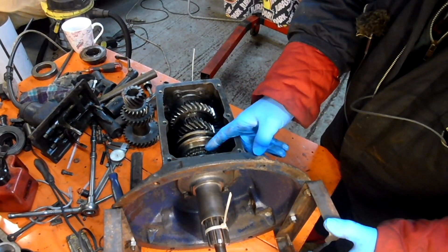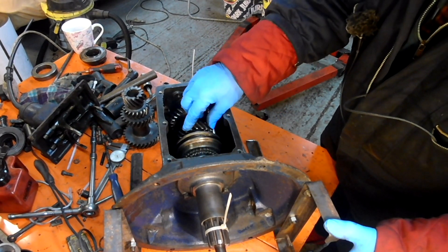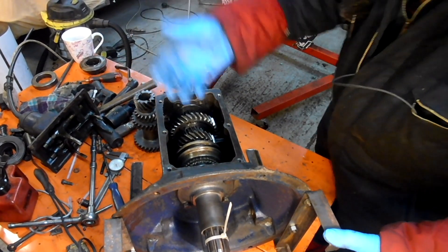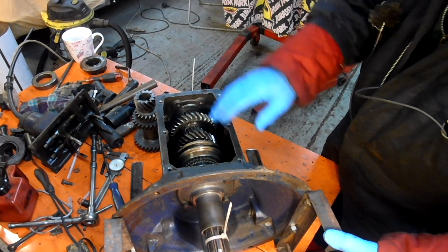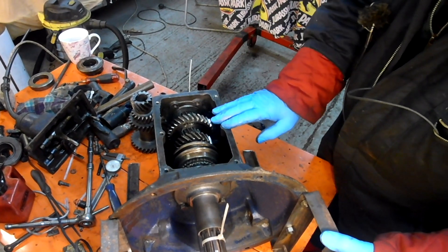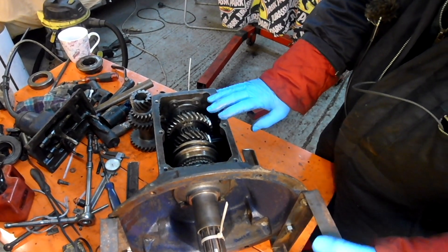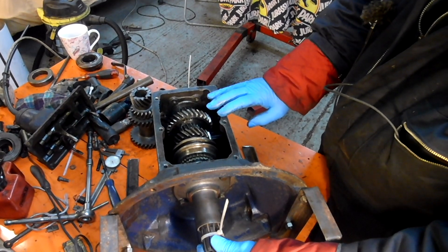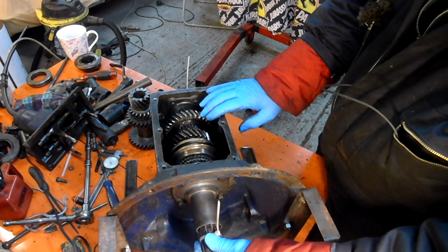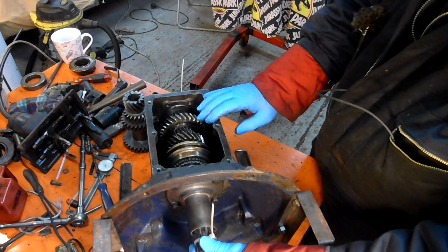This gear's a synchromesh. This gear runs constantly in mesh with this gear — so this is called a constant mesh setup. And this is a sliding gear. So that's it — a Ford three-speed box in very simple terms. Three speeds, one of which is straight through, one to one. And a reverse. Dead simple, not much to it. Very compact as well.